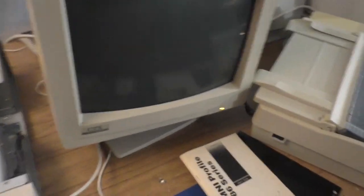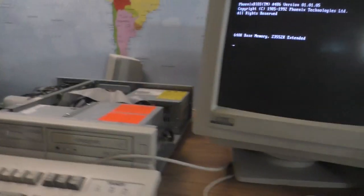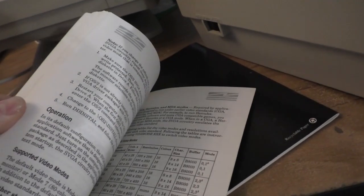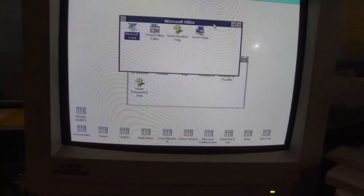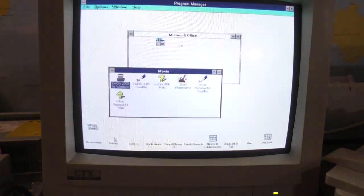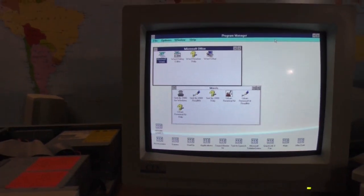Today we're going to talk about video memory and the hassles therein. I found the installation manual for the overdrive chip. So I found a problem with this machine, and it's a doozy. This computer actually does have upgraded video RAM — it is a user-upgradable option on these machines. If you look in the owner's manual, there should be a section on video memory. If the system is set for any SVGA mode or anything above 640x480 16-color mode, we start to get artifacts on the screen.